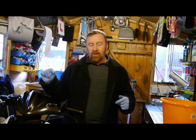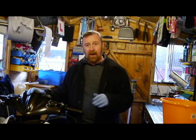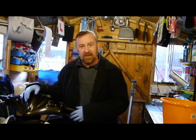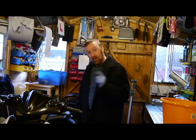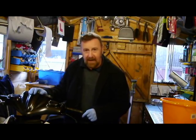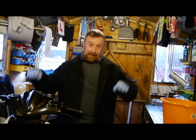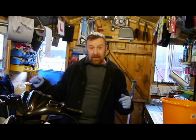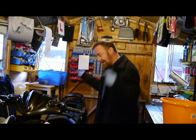You're giving it everything and not going anywhere. I was losing a massive amount of speed - 48 mph, and any incline brought it right down to 22-25 mph. I was doing 30 and a lorry went by and blew me back. I actually laughed out loud in the helmet because I knew what was wrong. It was scary too. But don't underestimate those rollers - clean them and the belt. The car driver thinks you're just being stupid revving behind him, but it's because you're not going anywhere. Anyway, let's get fixing this bike.